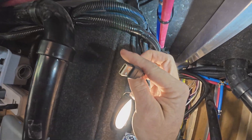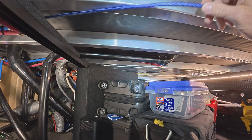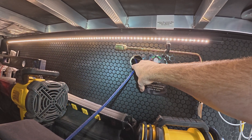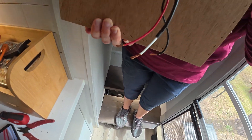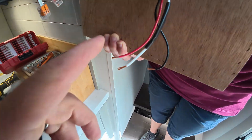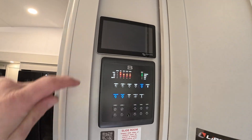Now I have our HDMI cable right here. I'm going to need a USB extension — the USB ports are over here, we'll get that figured out. I need to reach these outlets which are about a foot away. Then I'm going to use some zip ties to hold this HDMI cable up. It's not the ideal spot to come through — I'm going to rerun a new hole later. This is going to be a 12-volt fan to circulate air into the battery bay from this heated space. I saved the wiring connections prior to disconnecting everything so I knew what to wire back up. Cable is routed through. RJ11 for the fan reconnected. One connector plugged back in. I just need to wire up the dimmer switch and put this back in.